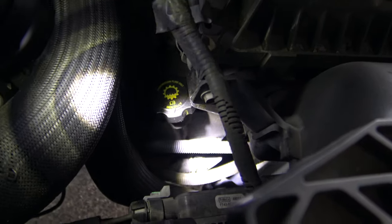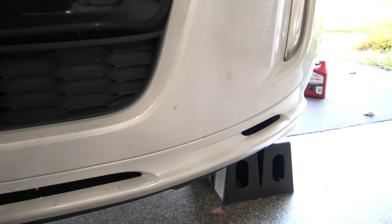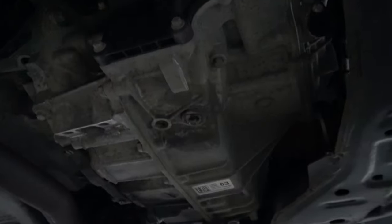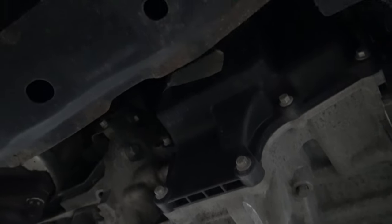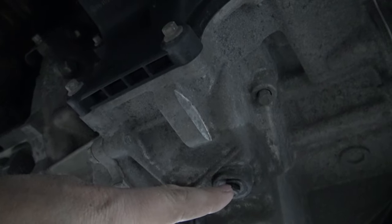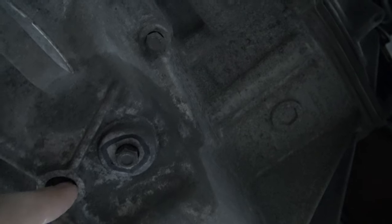The fill cap is going to be underneath your air filter box. I'm going to shine a light down in there — you can see it right there. It says 'transmission fluid only, Mercon LV.' Now I'll show you where the drain plug is. You're going to go down underneath the driver's side of the car towards the front. It's going to be right there — I've got it circled with the Sharpie marker. This is your drain plug. If you come back out a little bit, you'll see this black piece — go straight back about four inches and that's the plug. It's right next to this pocket in the casting.